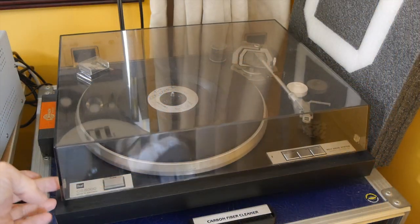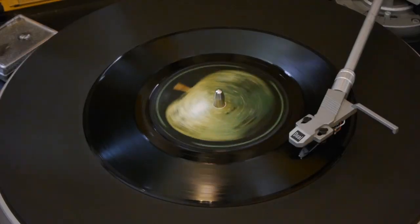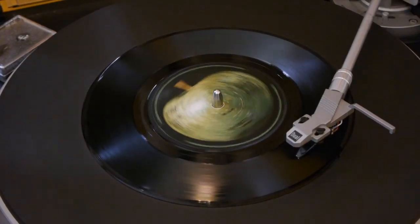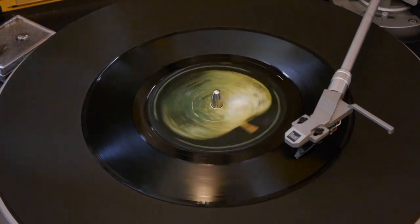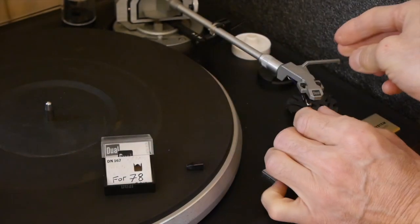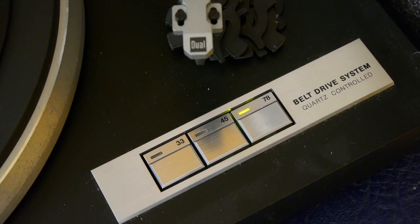Amazingly, I have a more modern record player that will play 78 records. This is my much loved Dual 5000 turntable, which I bought back in the 1990s when I was a teenager, and it's doing sterling service even to this day. All that's needed is a change of needle from the diamond or sapphire one that it's got to a special metal one and a speed change, and then it's a 78 RPM gramophone. Allow me to play you a couple of examples of it in use.